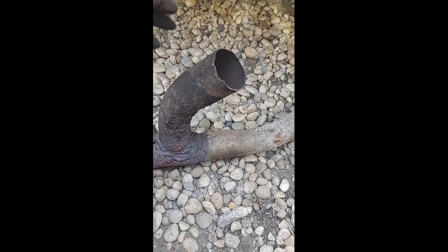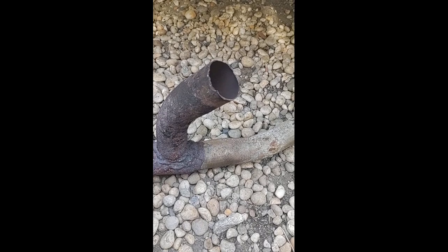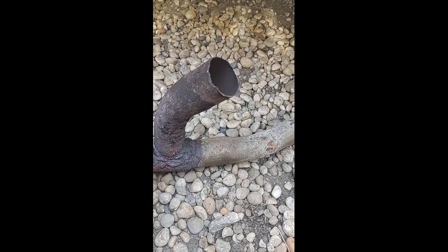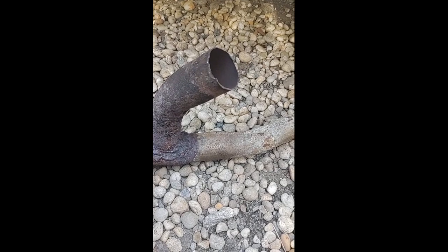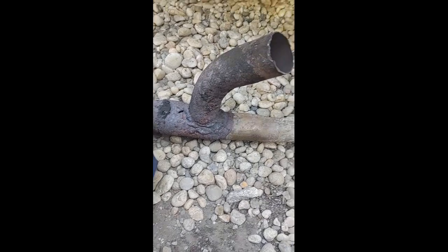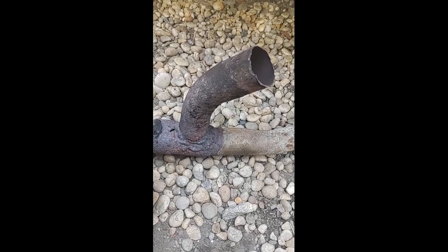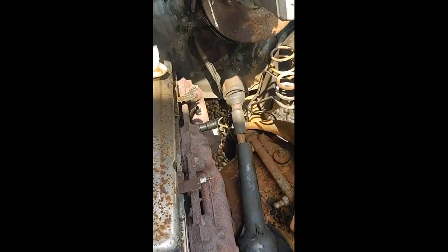I tried to save it, but this Y-pipe is not available. The only one I saw that you could technically buy was for the bigger car, and it's not going right from the factory. They can order it, but it doesn't ship until around May 25th and it's $125. So I've got to come up with something, because I also need to change all the studs, which means removing the exhaust manifolds — otherwise it's impossible. This is an all-day job.